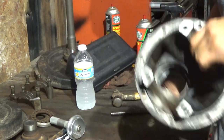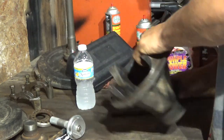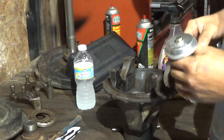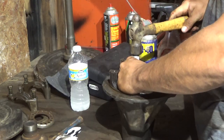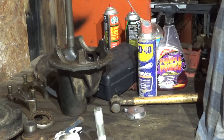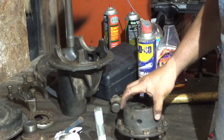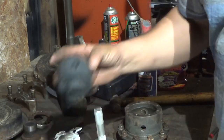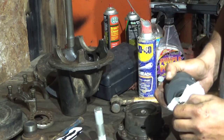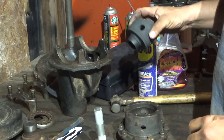You can actually feel it when it's flush, or you can kind of look in there and tell when it's seated all the way down. Now would be a good time to go ahead and put the mini spool inside the differential carrier. According to the instructions, it doesn't use the side shims, so just drop them in.